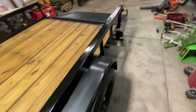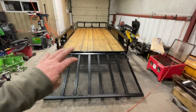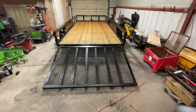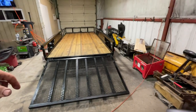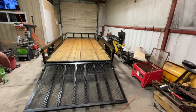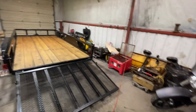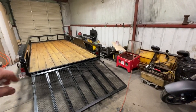And that's a good thing to do for any of your trailers in the future. Just once a year or twice a year, go over it with a little spray can and touch up. Trailer dealers do that. If a smaller company was buying these Carry-On trailers, not a large company like Tractor Supply Company, they would get a shipment of, say, 15 trailers on a truck. Their job as a representative is they basically do the quality control once it's delivered on the spot, because they're going to get a little scratched up here and there in transport. So that's the point when they hit the ground at the dealer, the sales place that's going to sell the trailer.